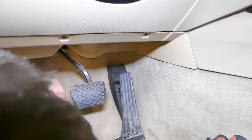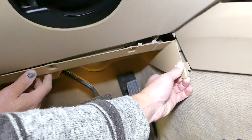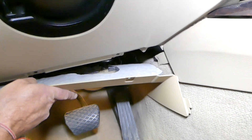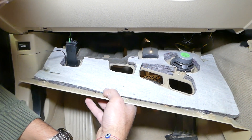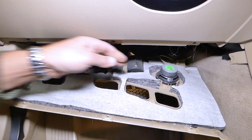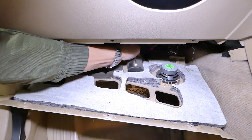Now you have to gently pull it out because you have wires holding it. You need to grab on this side first to come out of here, then you need to come down. We'll have some cable speakers to disconnect as well here. There is one thing that we press down and pull it out. Disconnect the little speaker, disconnect the light — the footwell light there.